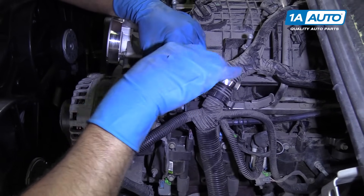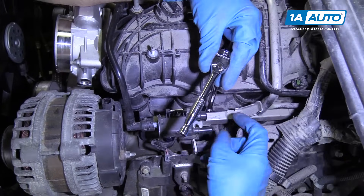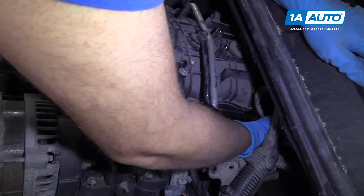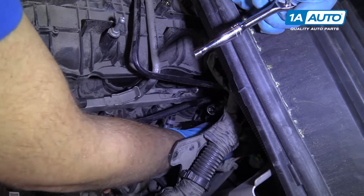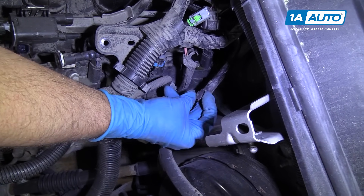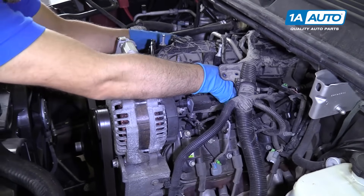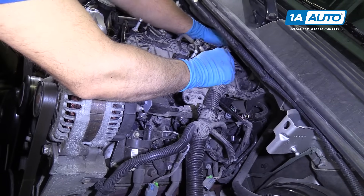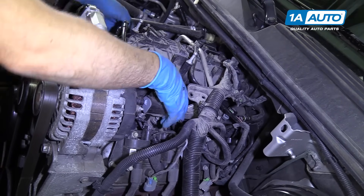Now we'll remove the bolts on this side — just move the wiring harness out of your way. Now there's these bolts right here for the fuel rail — we're going to leave those attached because the fuel rail is going to come up with the intake manifold. Now we're taking the last one out. This vent hose right here is in my way, so I'm just going to move this — this is for the PCV system. There's a little lock on this over here, you just push that lock and then pull the hose up. So now all my intake bolts are loose and disconnected, so I'm just going to move this wiring harness out of the way a little bit. There's a little shield on the back here.